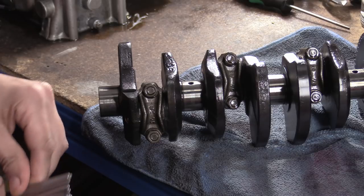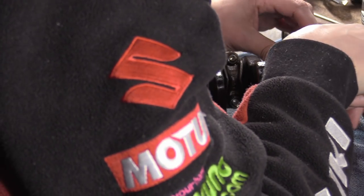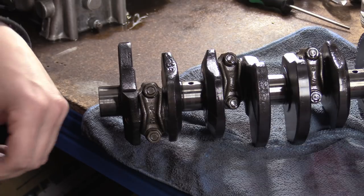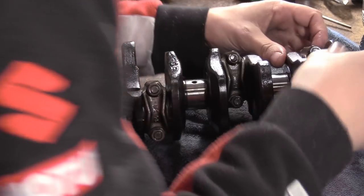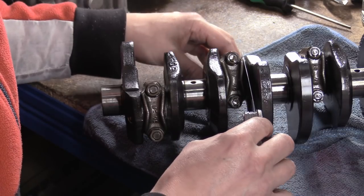Go along with the 100 micron blade and thrust the rod to that side. That fits but it's a bit tighter. That fits in there — so we were going for 200 microns. Let's see if 200 microns fits in all of them — we know it fits in the first one. That's a bit of a squeeze but it will fit. That'll fit but it is a squeeze. That fits as well but it is a tight fit. This one seems to be the worst one — actually that will fit in there.